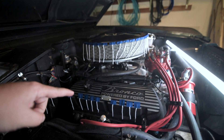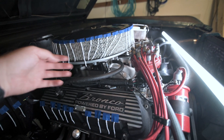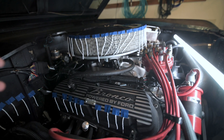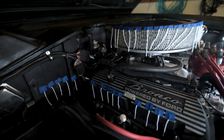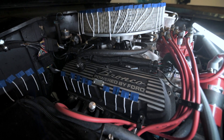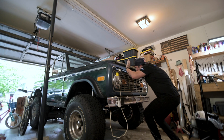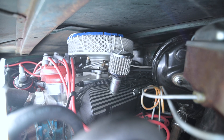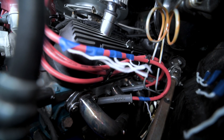I've got this string here and I'm just going to test if the air moves. It's like a little makeshift air tunnel — if the yarn moves, that means you've got airflow; if it just sits there, you don't. I'm running the engine at idle, closing the hood, and filming the air moving past different parts of the engine. I'm looking for air moving across the air cleaner and across the headers.